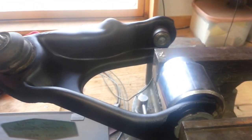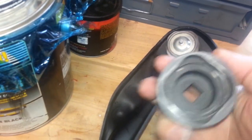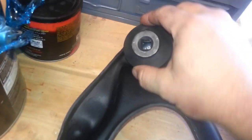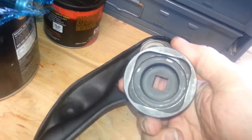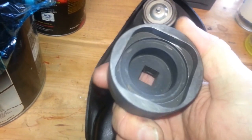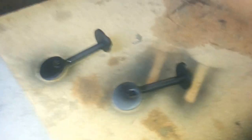Tip: if you're going to put in new bushings, go ahead and get your ball joints replaced while you have it apart. There's a special socket for these — the threading on the upper control arm ball joint is a really coarse thread, not a press-in type. You can get these sockets on eBay from different manufacturers. That's really the only way to get those bad boys off — they're kind of square, kind of a pain, and very difficult to break the old ones loose. They're about 30 bucks on eBay.